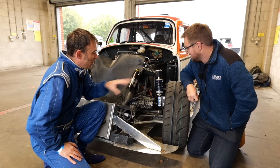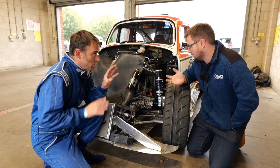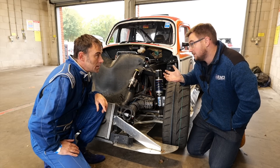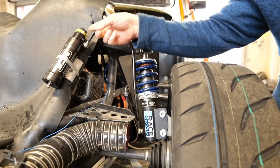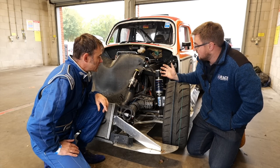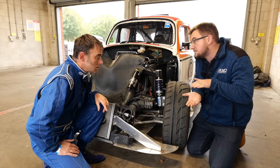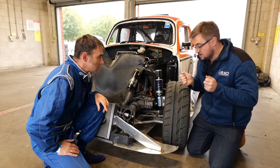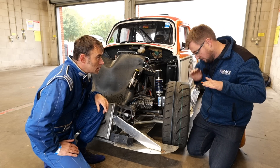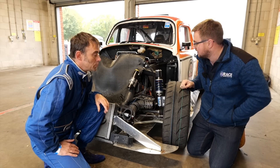So, take us through what we've got on here. We have a three-way adjustable damper. Three-way means it's adjustable in low speed compression, high speed compression, and rebound through the top. The high speed is fast wheel movement — like if you hit a pothole, that's a high speed hit. Low speed covers weight transfer, roll and pitch. Rebound is how fast the wheel can come back into the ground — if there's a hollow, it's how fast they can track the surface.